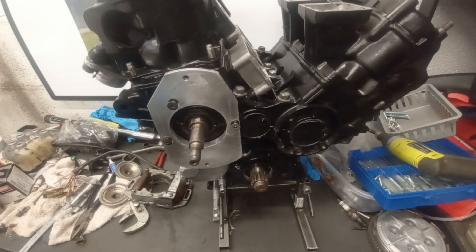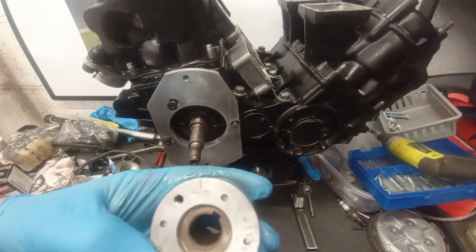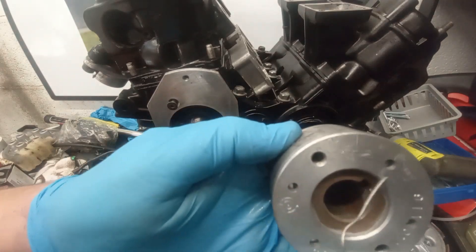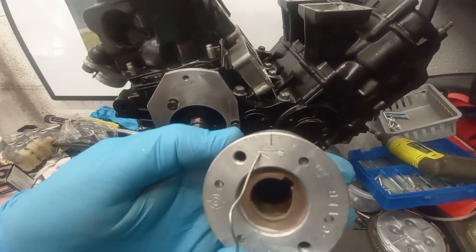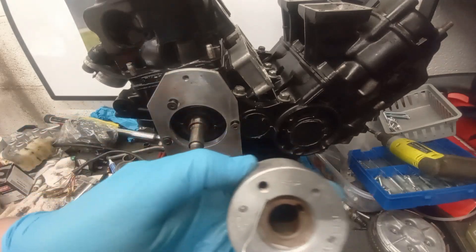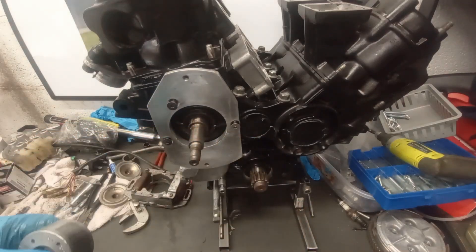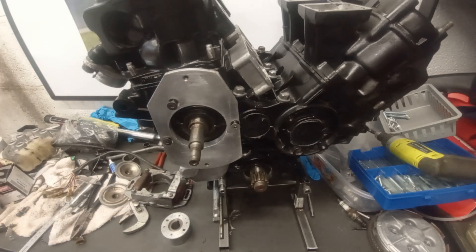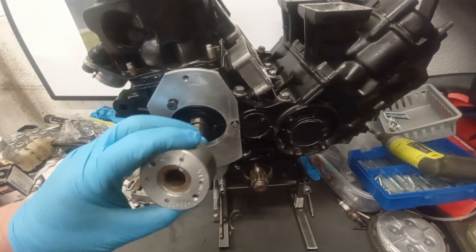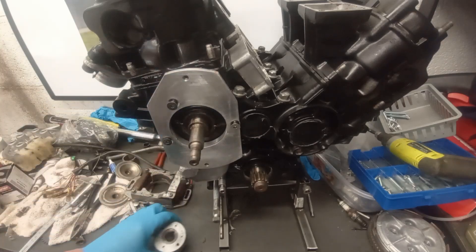He wasn't sure whether it would work or not, so he made a test rig and ran the system up to check it. And if you look at this, he has put marks there for the keyway, but also a directional rotation, which is right for the RD500, not for the TZ. So he's put his own little marks in there to say this is an anti-clockwise running rotor. And the system runs perfectly well in either direction, which he wasn't sure about, but he had to make a test jig, run it up, make sure it would work. So, there we have it.